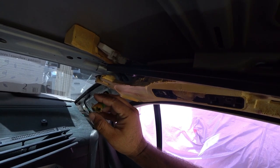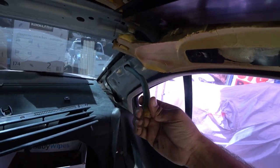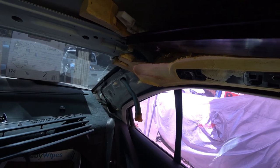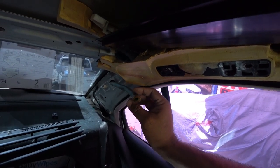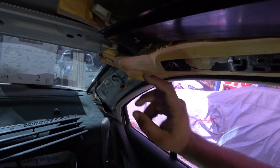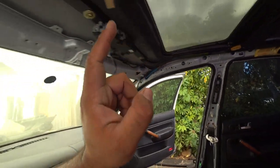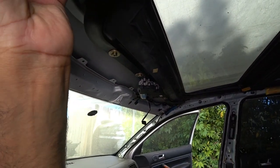This one's already done — it's done for. This is super common, a very common problem with Mark 4's. These tubes break and they leak, and they don't drain water where they're supposed to go, so you get water in your car. To solve this problem, we need to go to Home Depot and get a drain tube this size. We run this tube from here all the way back down. You need to service all four of them — there's one, two, three, and four. These things are notorious because they're so old. These cars are 20 years old, so they're going to leak.